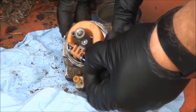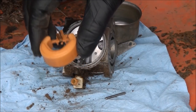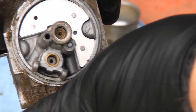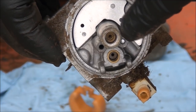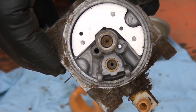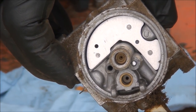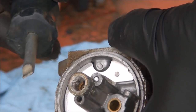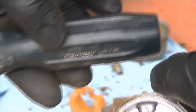You can take off the float real easy — you just pull out this pin and the float. You can see the float valve here comes right out. This float valve just sets in there so it'll just pop right out of place. This carburetor is in good shape, nice and clean on the inside. One thing we will have to do is take out the emulsion tube, which is that brass piece down in there. You need a slotted screwdriver to get down in there. Be real careful because if you don't have the right size screwdriver — they actually make a special tool which I have. It's very easy to strip out that brass piece and then you're screwed. This here is the actual tool — it's a special tool from Briggs and Stratton.